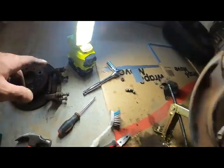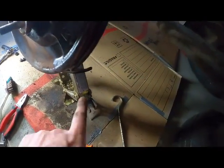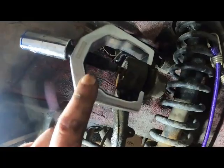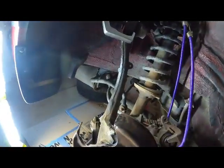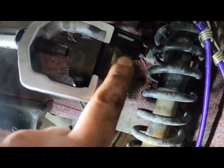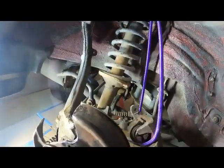We managed to remove the rotor with the screws — loosened this one up and it's now freely moving. I jacked up the axle so the suspension wouldn't expand on me while I work. This is a ball joint separator tool — you just line it up on the tie rod and as you tighten the screw it pushes the joint out. The reason it's jacked is that once the joint is released it's free, so you need it at a certain angle so you can put it back once you're done.